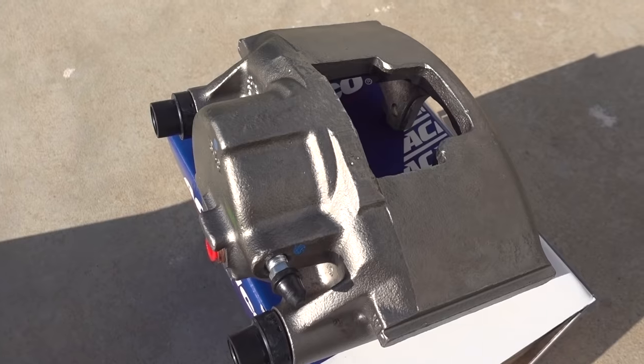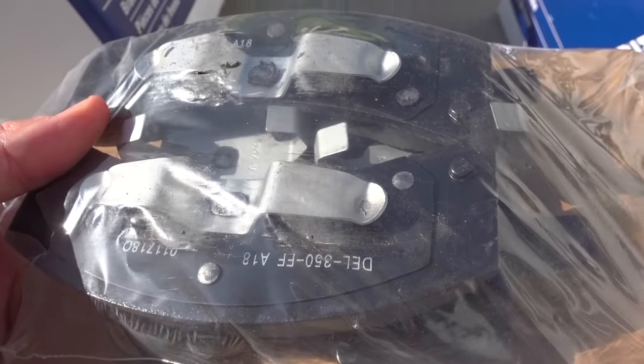I couldn't be more happy to report that the brakes are awesome. They're not squealing one bit. They feel nice and even, no pulsing, nothing like that. I've been driving around for a while, and I can tell you right now, guys, I'm very happy because this has been quite a big problem and I've been working on it for quite a long time. You can see I just came to a complete stop with no sound whatsoever. The truck is now fixed. It's all ACDelco OEM stuff — ceramic brake pads — and I will link everything in the description below. I am getting a little bit of smell from the pads, but that's normal — it's just the bedding-in process.